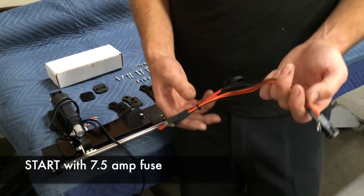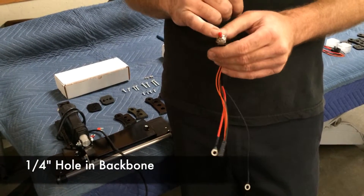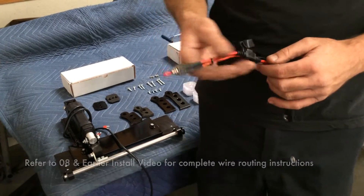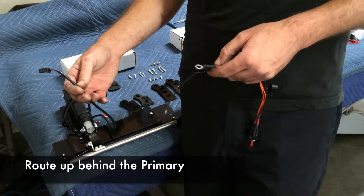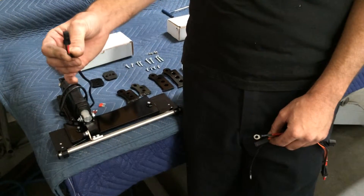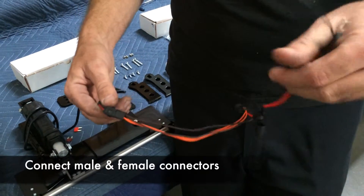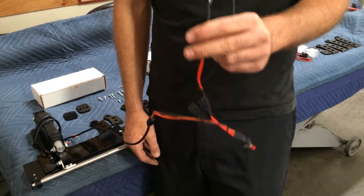You'll go ahead and start with your 7.5 amp fuse, and in most applications for the Harley, there's a quarter-inch hole in the backbone — which we'll discuss later in our install video — where we like to use this switch, which would ultimately be on the inside bottom if you were riding. We would route this up behind the primary, as discussed in other install videos, and around the battery compartment. You'll notice it has a male connector, and this unit has a female connector, and really that's all your electrical install that you have to do. Route these to the battery, you've got your quarter-inch switch, and you've got an active unit. That's as easy as it is.